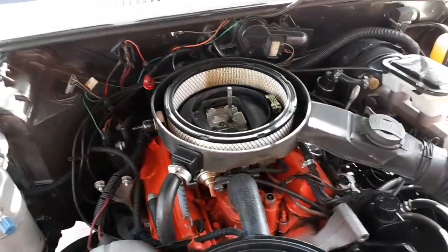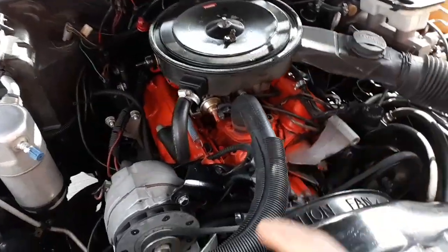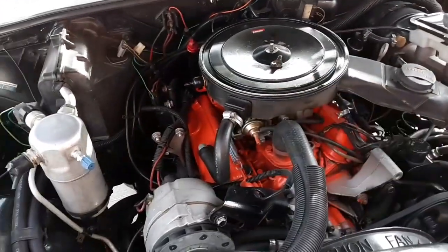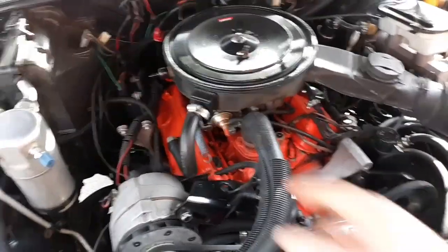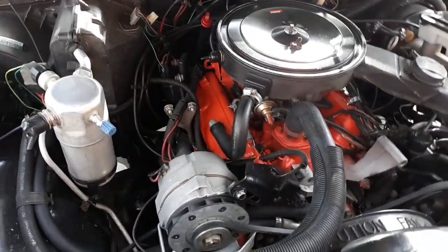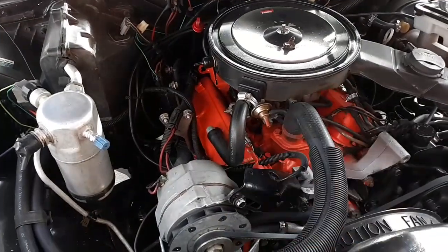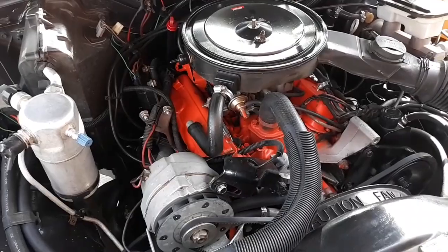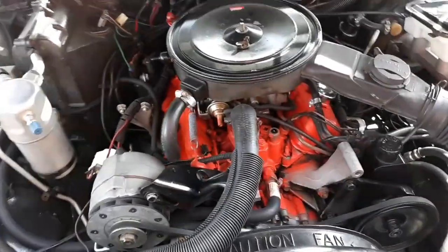It was just nasty. And that's the first time it's happened that bad. Now, it's plugged them up several times. And like I said, I just keep them in stock, change them out when I notice that they're filling up. I tried the breather filter inside the valve cover, one of those. Well, it plugged that sucker up, and it started leaking out on the exhaust and burning it while I was driving it. That's not a pleasant smell. So I went back to the original type.